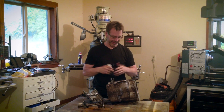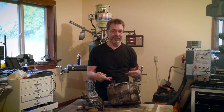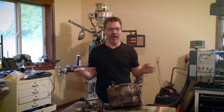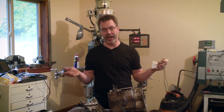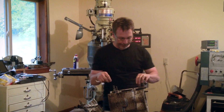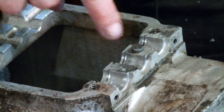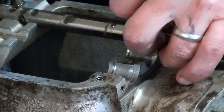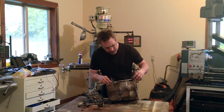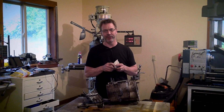It's done. I don't know how many hours — not that many. The milling section took 20 minutes tops: bolting it down, lining it up. Making the cutter was the hardest thing to do — that took a good hour. So I'm really happy with the results. What I ended up doing with that homemade fly cutter is just cut a groove so that the O-ring could fit right in there. Let's see if I can get a little better seat there — yeah, there we go. Hopefully this won't leak as much next time I put it in the truck.